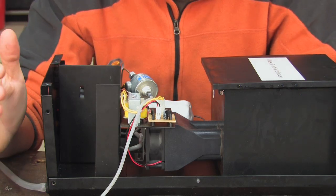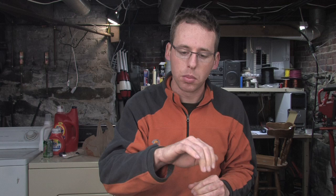It's actually a lot simpler than I thought. For a quick overview: the fog liquid comes into the machine via that little pump, then it goes into a little heater core which heats up the liquid and turns it into a vapor. It comes out of the heater and it's mixed into relatively cooler air. In that cooler air the vapor condenses and forms what's essentially a cloud which comes out of the machine. And that's what you see — the fog.